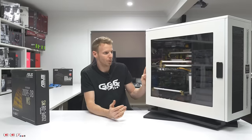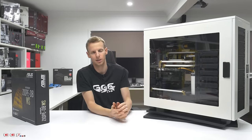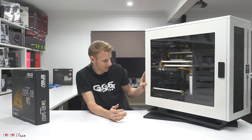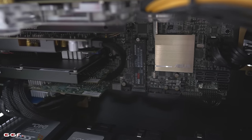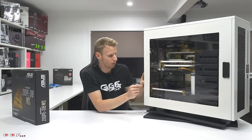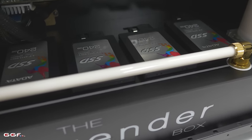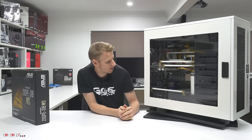Storage-wise, there's about 40 terabytes in here all up. There are WD Reds — I think they're 6TB — and a lot of 4TB Blacks for some of my performance arrays. I also ended up buying a Samsung 950 Pro NVMe as my boot drive — that thing absolutely flies, clocking at about 2.3 gigabytes a second, which is insane. ADATA also sponsored four of their SP550 SSDs. I've thrown them in RAID 0 for a scratch drive and they get something like 1,700 megabytes a second, which is really nice.